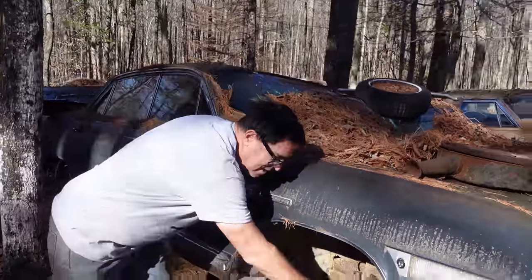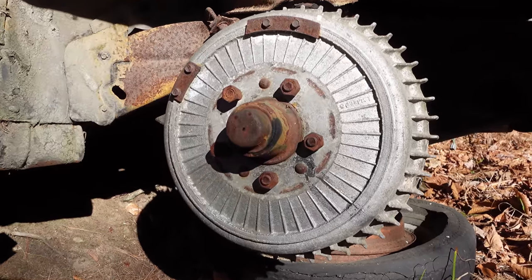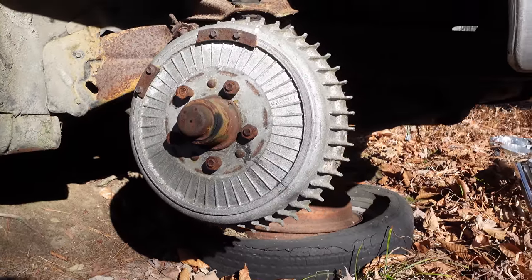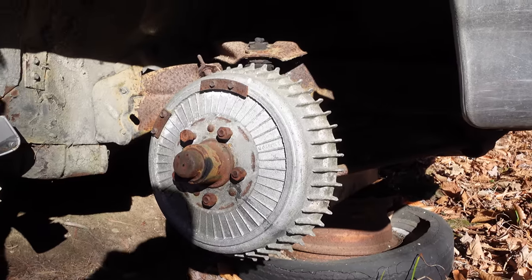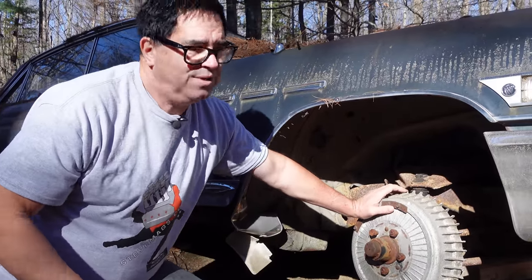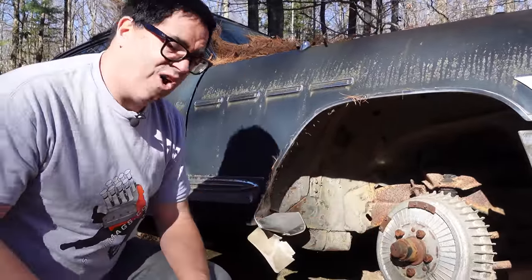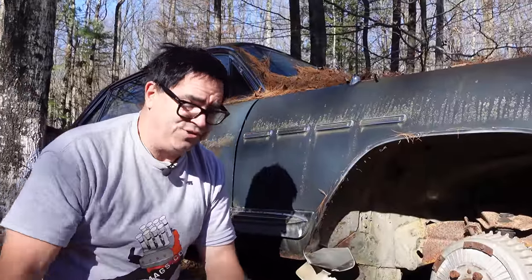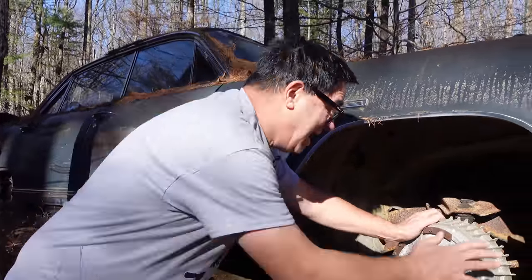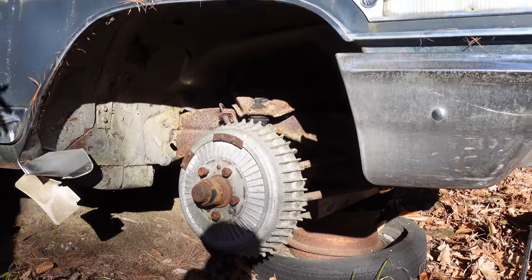Getting back to the brakes — look at this massive brake drum. It's a 12-incher, and that's not been painted because it's actually aluminum. As the 1950s unfolded, American cars got to be two tons and then almost three tons. Buick was one of the first to address the fact that the brakes just weren't cutting it. In 1959 — actually 1958 on the full-size Limited — Buick released aluminum brake drums. Nobody else in the industry did it; Lincoln did it in '61. This was a Buick thing from 1959 through 1969 — massive aluminum structures on all full-size Buicks. The muscle car Buicks of 1965, '67, '68 — the GS 400s — came with a nine-and-a-half-inch iron drum. They never used the big drums on the GS muscle cars, though they should have. These massive aluminum drum brakes were also classic with hot rodders who would adapt them to '32 Fords and all kinds of other stuff.